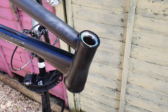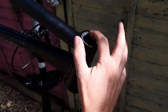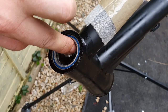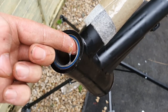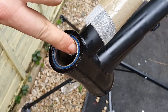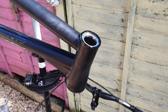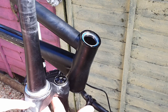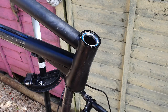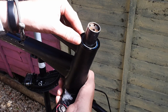Now comes the time we're going to install everything together. We have our frame, our cups top and bottom, and we've also pre-installed our bearings top and bottom. I'm just going to add a little bit of grease to the inside — this will stop any creaking between the steerer on the fork. Next, we need our fork. The fork is going to insert all the way up to the crown and into the bearing, then we slide it up and out the top as far as we can push.